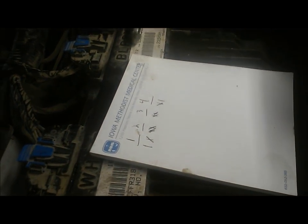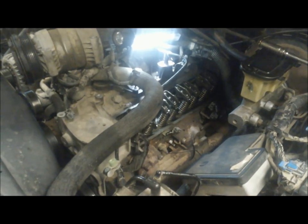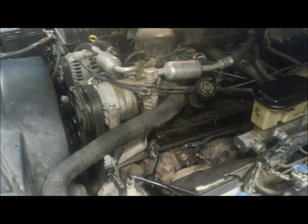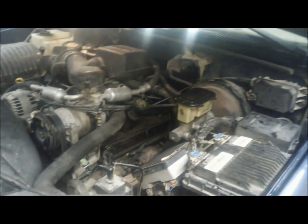If you're in a tight spot like the back of the engine, you can take two quarter turns — whatever you have to do. We're making a mark on which valves we've done; we have two to go. Then we'll fire the engine up and see how it goes. Adjusting valves is just that simple. Ideally, mock everything up and fire the truck up before you have all the belts and everything reassembled, so if you make a mistake you can go back and adjust. But we're confident this is going to work out.